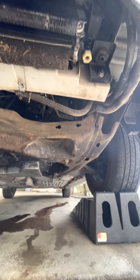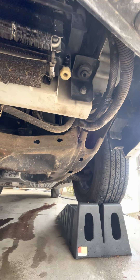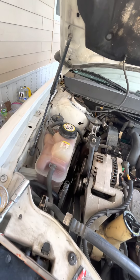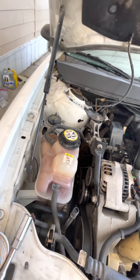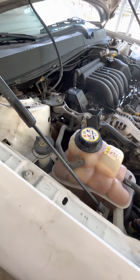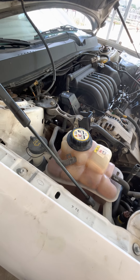I'm also working on the radiator. That's the plug for the radiator right there — it's a plastic plug, easy to remove, but you've got to be careful. You run some water through there, let the thing drain out. There was a lot of rust in there. I wasn't getting a lot of heat from inside the car, which means the heater core might be plugged up, even though this car only has 75,000 miles. It is also an older car — 19 years old.